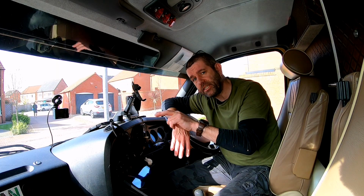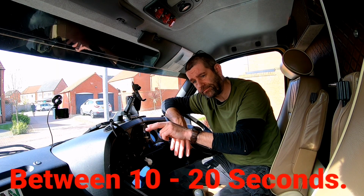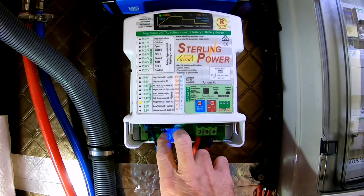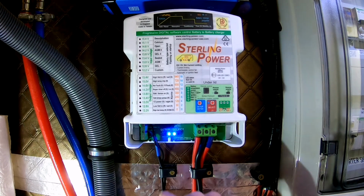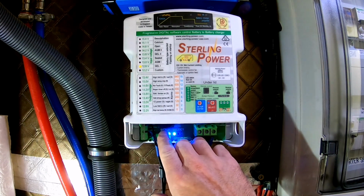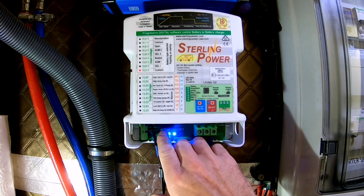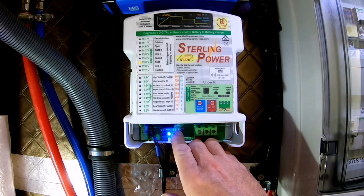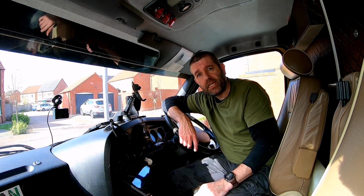Press them in for 10 seconds, hold the buttons down, and after 10 seconds release the buttons, and with them 2 toggle switches you should be able to pre-select the battery charging settings you would require. Once you've selected your charging settings, leave it for 30 seconds and it should store within the B2B.